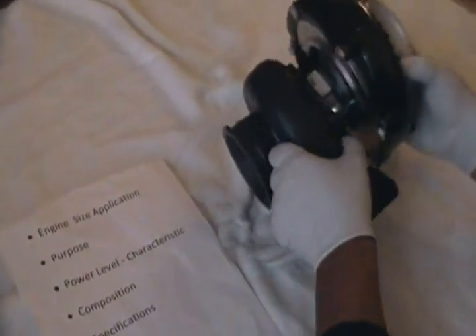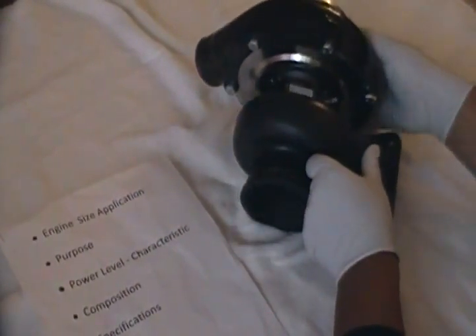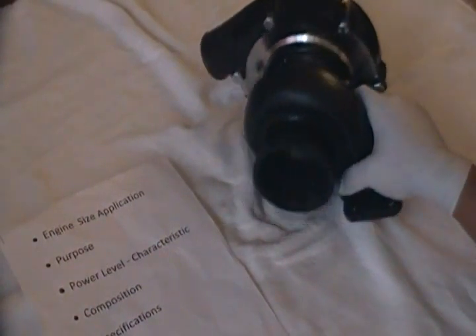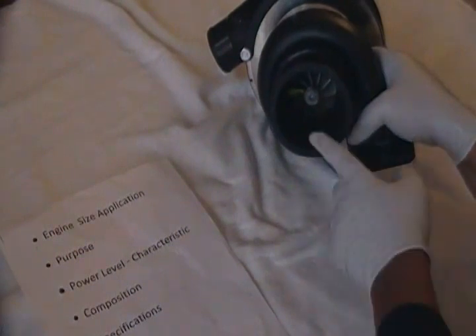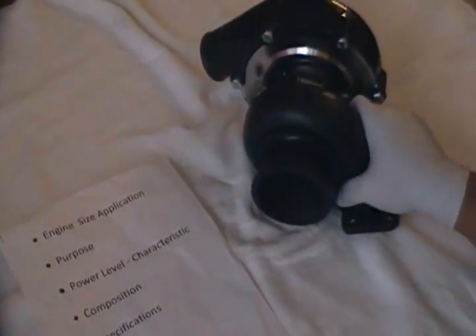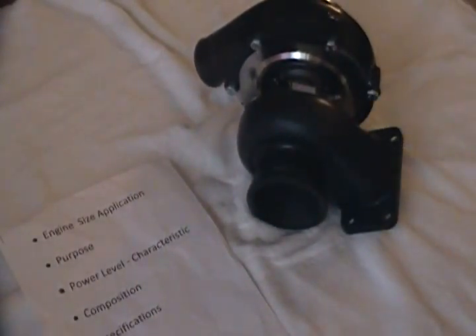The turbine has options just like any other GTR family. This turbo is specifically sold without a turbine housing because a person may already have a GTR series and want to simply change cartridges. This turbine uses the same exhaust wheel as the standard GT3076R — a 60mm wheel diameter with a 55mm exducer and an 84 trim — so the same turbine housing is able to fit with it.